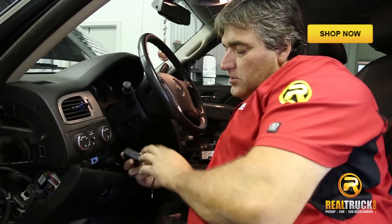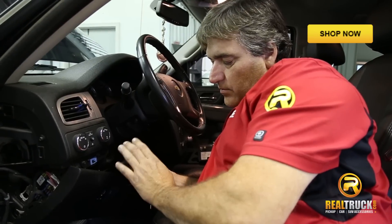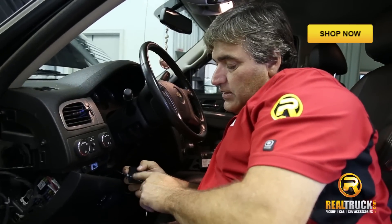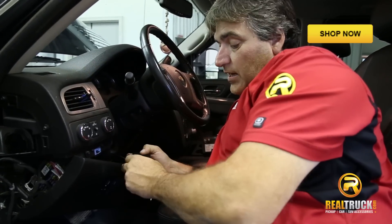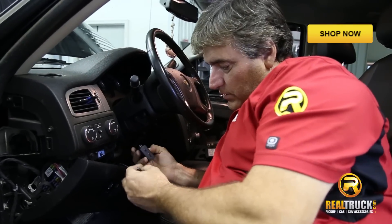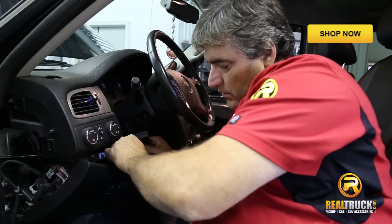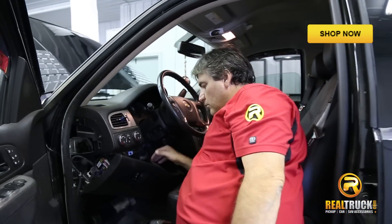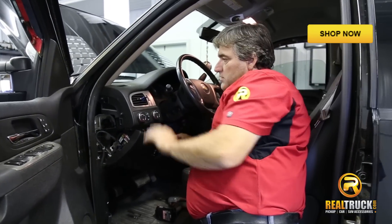When you get ready to start hooking up, this is your power coming from your OBD2 connector going to your programmer. Now there are two settings on this thing — make sure you have it set on key and not battery, because the battery setting will make it powered all the time and we don't want that. We want it on key so it's only key powered. Then we'll plug in our power cord and grab our connector cable which is our HDMI cable, connect that up, and get this all mounted in a nice neat spot.